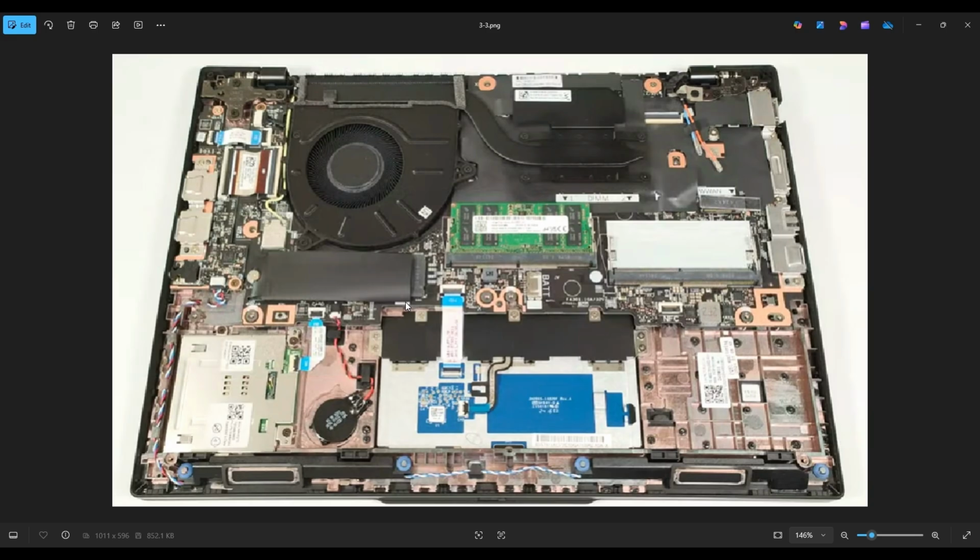And if you're here to reset BIOS, just one word of caution: this will usually only reset your BIOS system settings, not your BIOS password. A lot of people try to do this to reset the BIOS password, and in most cases, this operation will not do that. I will have more information on BIOS password resets below in the description.